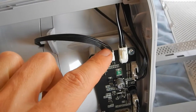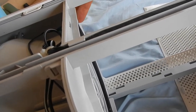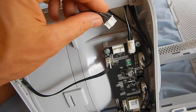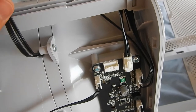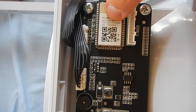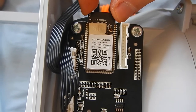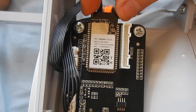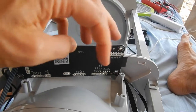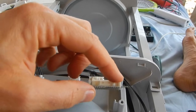This is the power going into the ventilator. There's a switch here that checks if the back door is closed or not. What we could do is power it on and measure on these pins what we get. The Wi-Fi unit has a MAC address — they say you should break pin number 2 because that's the plus, and pin number 1 is minus. I'll unscrew this and check the labeling on the other side. The Wi-Fi module is here with no labeling; the labeled connector is for the display.